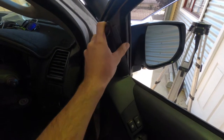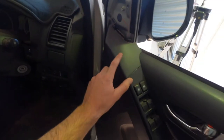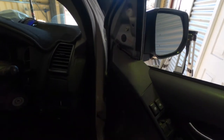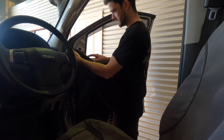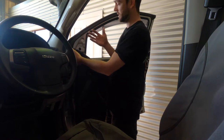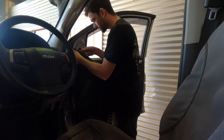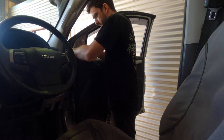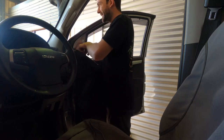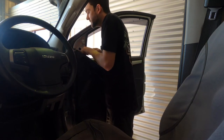Let's get into it. I'm just going to remove a few little panels in here. This top one - that was easy, there's a little pin on there. We've got a couple of bolts. Let's try and prise this off - it's got all the controls. I might put the camera down and prise that off carefully. This is proving a little bit more difficult than I thought. I can't see how this panel comes off and I don't really know that much about it, so I'm going to try and leave it on there and flex it out just enough to get the plug undone. The trick is going to be getting these out without dropping them down in the door cavity.